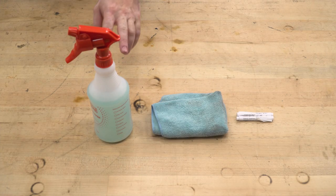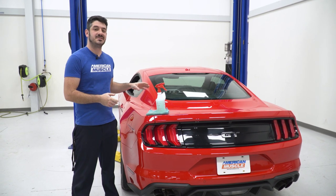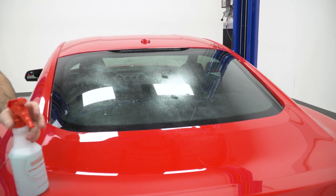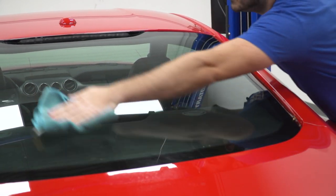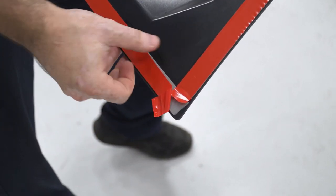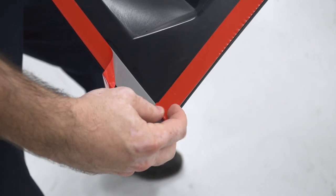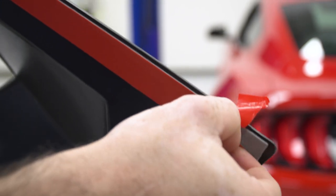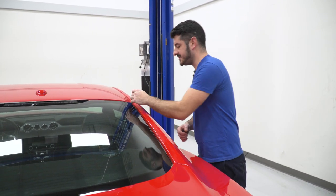The tools used for this install are glass cleaner, a microfiber cloth, and the provided adhesion promoter. The first step is to make sure you're starting with a clean surface free from any debris — use a little bit of window cleaner and a microfiber cloth to make sure the surface is nice and clean. Then peel the tabs for the double-stick tape on the back and fold them over the front. Don't peel them all the way so you can get everything lined up and make adjustments before peeling the rest of the tape. Before sticking the louver into place, use the provided adhesion promoter and go right around the edges of the glass — this will help make everything stick really well.